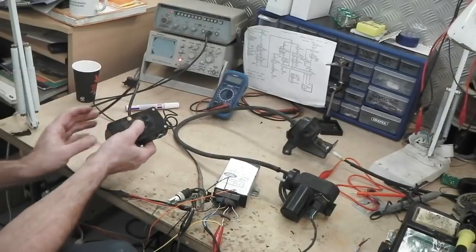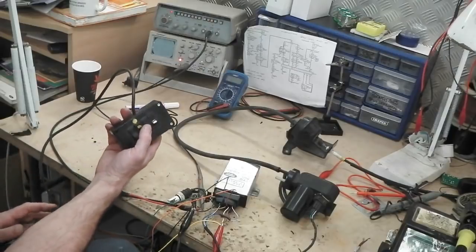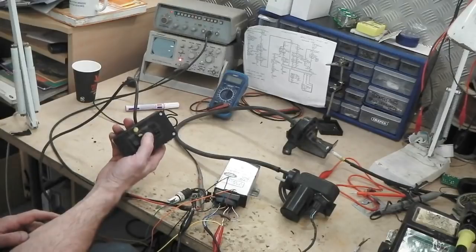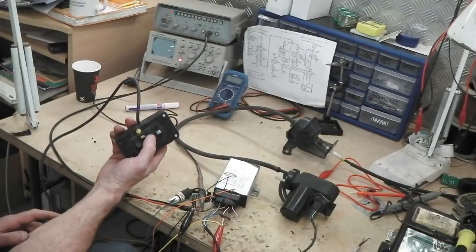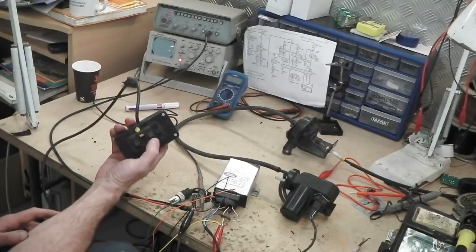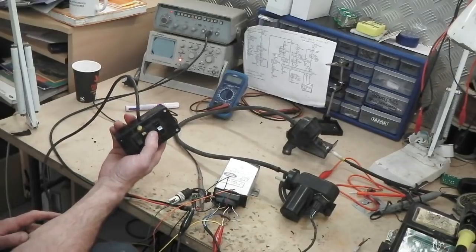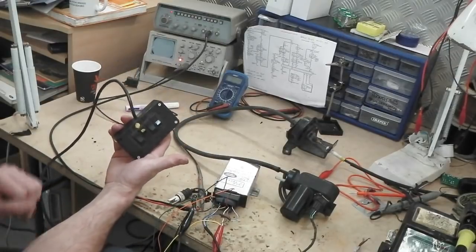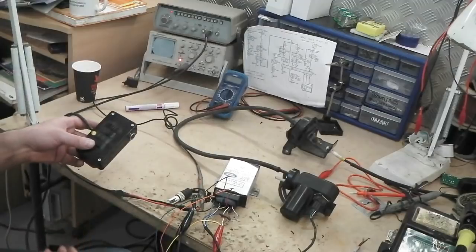Right, so we can coast and resume. There's coast, so that turns it off. Resume will take it back to where it was. Just about there. Lock out, coast, got back to my speed, locks it where it was. Brakes on, loses it. Off the roundabout, back onto the dual carriageway, wherever we're going, resume. It always lands in the same place on the bellows. Let's take you down now, show you that working.